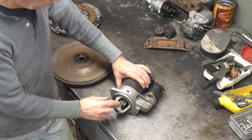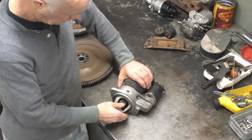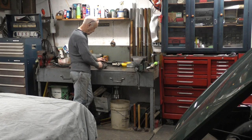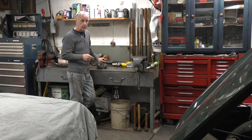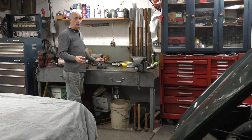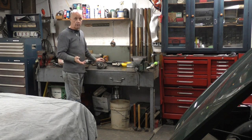Looking at the starter pinion — when I first took this off a couple of weeks ago, the teeth are okay on the pinion, which made me suspect the ring gear was damaged. When the car stopped on compression, with a six-cylinder it'll only stop in three places on the flywheel, which is 120 degrees apart. When the starter failed, you could put the car in gear, push it forward about a foot to move the ring gear around, and it would engage the starter straight away — click, like nothing was wrong. So obviously the problem is on the ring gear.